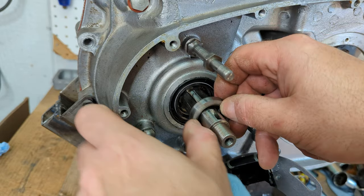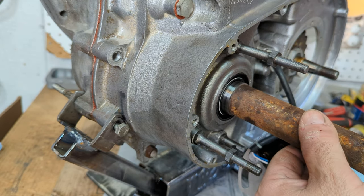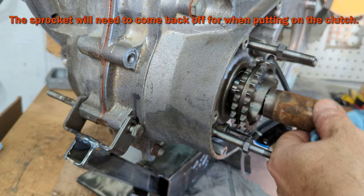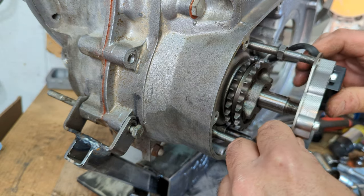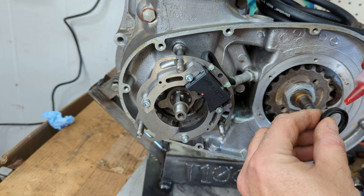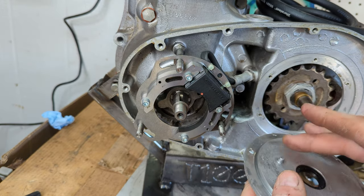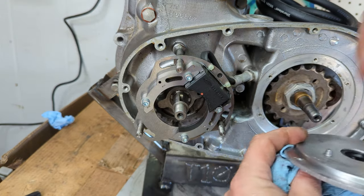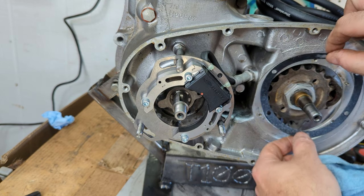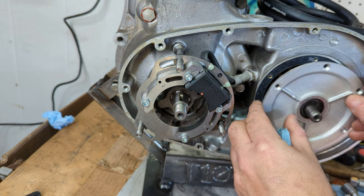So I'm going to go ahead and put the spacer on now. I'm going to use the 518 again. That nub means nothing. I have a feeling it was from casting. You can see it right there where it feeds the aluminum into the mold. I went ahead and sprayed Hylamar on both sides of the gasket. Simply fit her on.